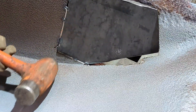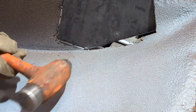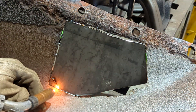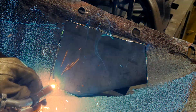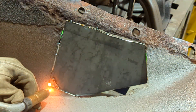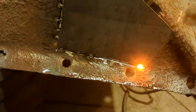At this point I've flipped the wheel well and I'm working on it from the inside. This isn't always possible depending on the project, but it's a big help if you can hit it from the inside as well. I make sure that my repair patch isn't too high or too low relative to where the original metal lay. If it's too high, I can tap on it with my hammer. If it's too low, I can use a pry bar and pull up on it and make a tack to hold it in place.